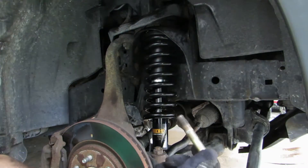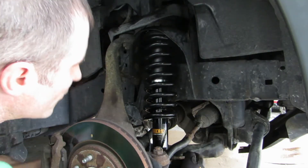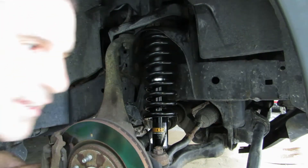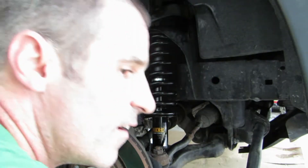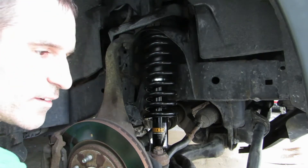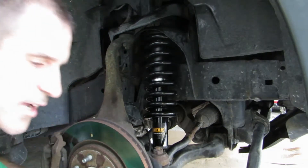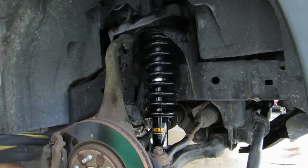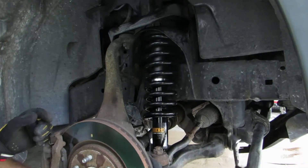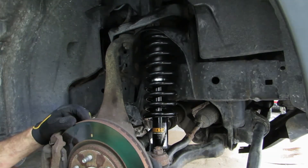Don't throw away the bolt that came with your old one — it should just fit right in there, because these new struts didn't come with a new bolt. Thread this on and grab the impact wrench with the three-quarter inch socket, and my three-quarter inch wrench on the other side — stick it on there and wedge it. And it'll be done.